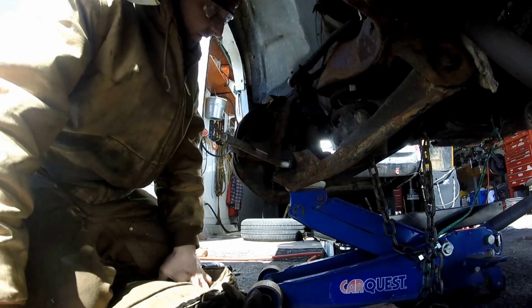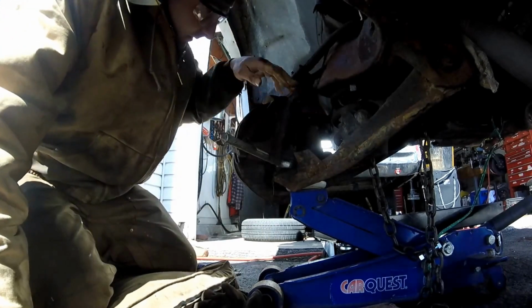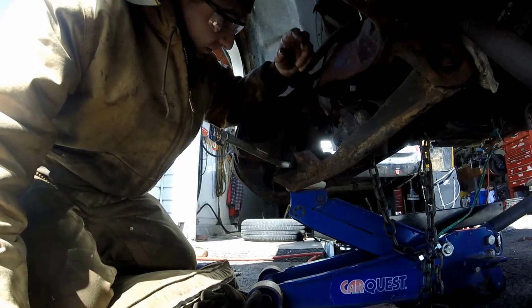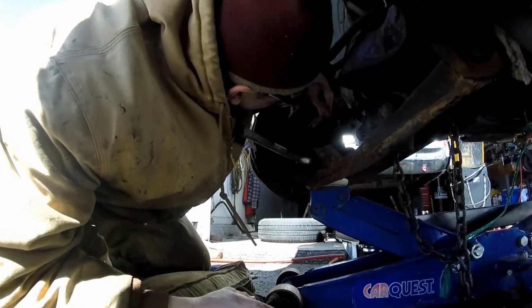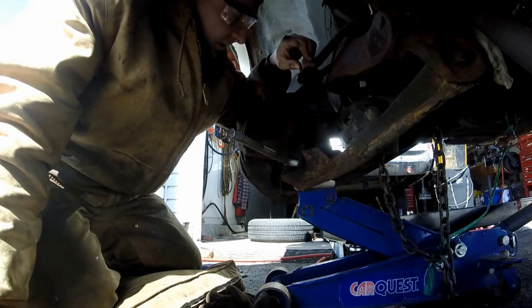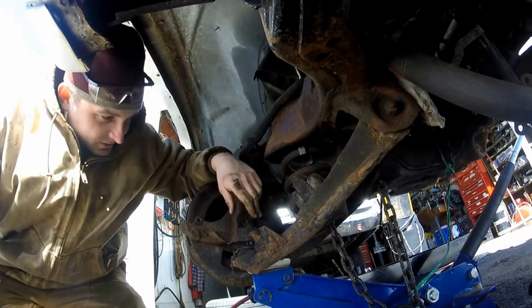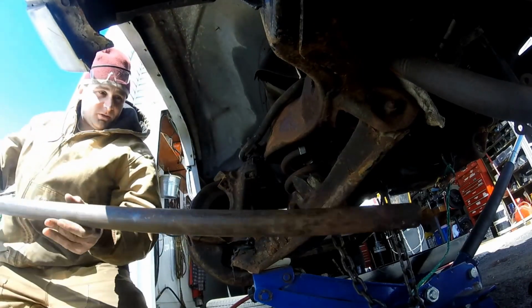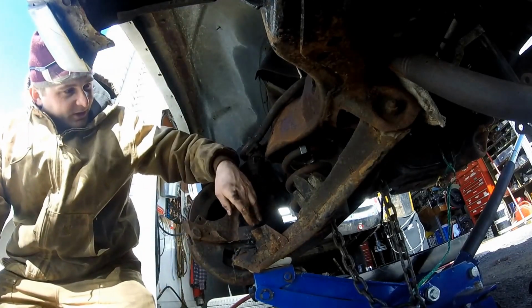So now it's just a matter of taking that off, releasing the jack, and the coil spring compressor should do its job in retaining the pressure on this, so you can release it as it comes out. And just make sure the chain's on and your claws are still attached properly. Just do some secondary checks. This can be dangerous stuff, so take your time and think it through. Guys, almost ready to remove this. There's a little bit of tension left on the jack. I have my reaching pipe, so I'm going to try to go from behind and put some leverage on it and get this totally off, and this coil spring should come out.